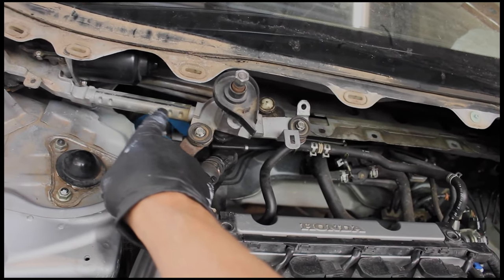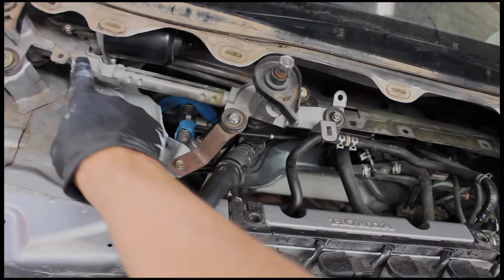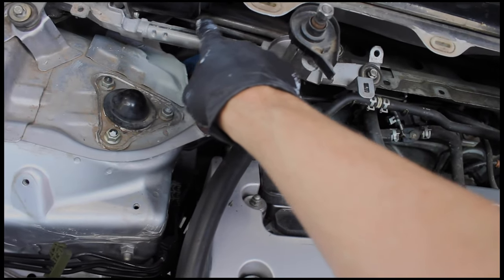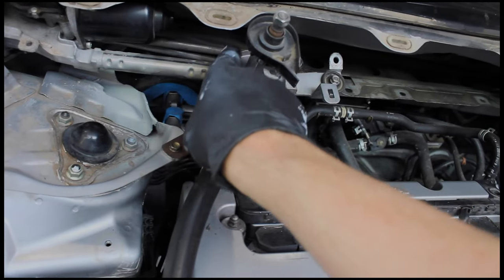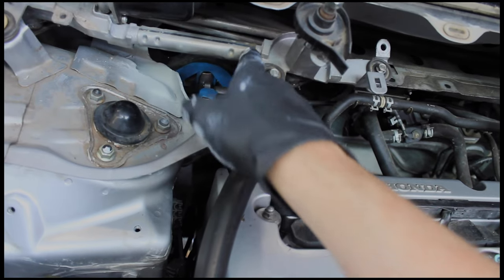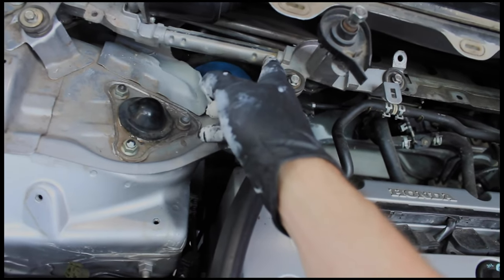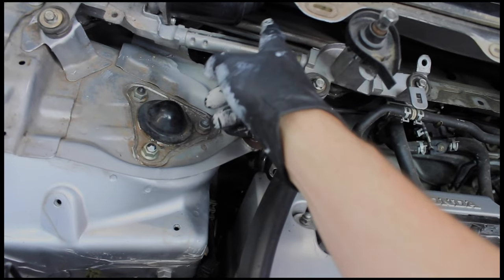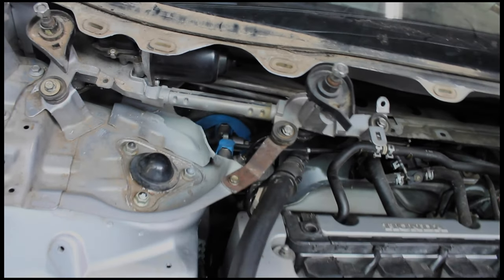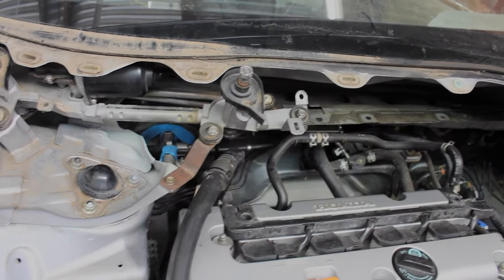Then we're going to have to modify this bar. The master cylinder is just there and the cap runs into this bar - it's aluminium on both ends with this steel piece in the middle. So I'm wondering if I can have this metal piece go up and around so that I can get in here, put the cap on, get the cap off and out. I might have to cut this back quite a bit and then use aluminium - cut this back, make a big loop that gets it out of the way, stays away from the arms in here, and then links back up to this piece. But let's clean these brackets up, put them back in, bolt it up, get it all nice and in position, and then I'll start working on that.